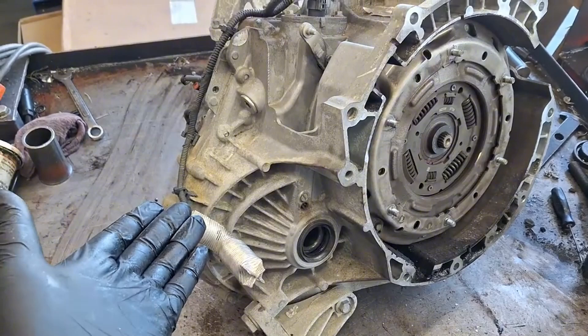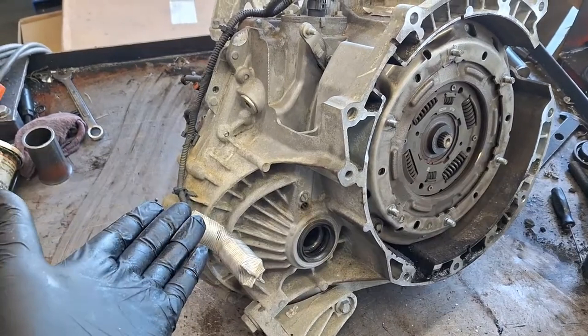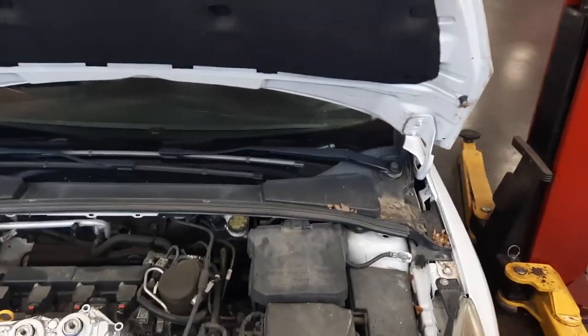In the past, what I've said is that you can't use a newer one in an older one — for example, an 2018 model transmission in a 2014 model Focus. However, I found some information online, actually a subscriber of mine found it. To be clear, the 2015 through 2018 Ford Focus and Fiesta transmissions have a different calibration than the 2012 through 2014 models.